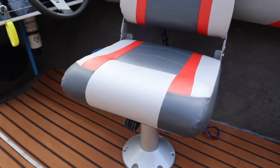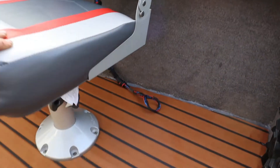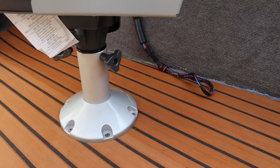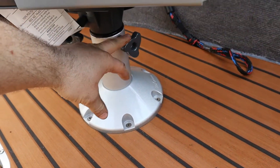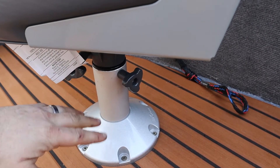Another thing that really didn't make it into the videos, other than just saying I was going to put it in, was the fact that I totally put a different seat in. I put more of a fishing-style seat in — I wanted to be able to get in and out of it a lot easier than the wraparound seat that this boat came standard with. Just personal preference. This seat happens to fold down. It is a seat from Cabela's, ordered and shipped directly to my house, and there is the adjustable pedestal. All you have to do is unthread this right here, it pulls out, you move it up, line it up with the new hole, put it in, thread it in — and you have a higher or lower seat.